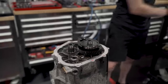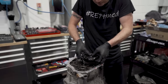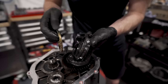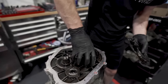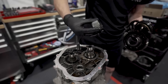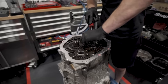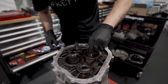Those are the two roll pins that hold reverse onto the shaft. Then you've just got the synchro behind it, the detents, the lock and collar, the shift fork, reverse gear, that was oil pump drive but also the reverse gear idler, needle roller, and then we pop that off — bearing carrier. And that is it.